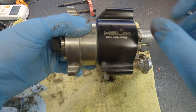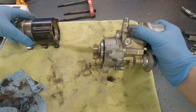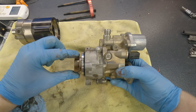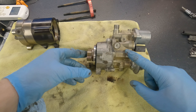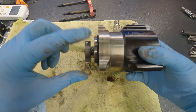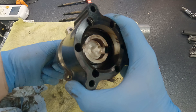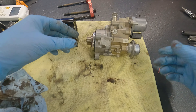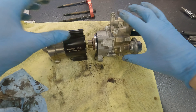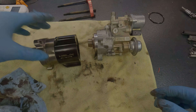Here is the actual Helix Overdrive — part number H3790. Normally your fuel pump sits on the drive chain, and as the chain spins once it pumps a certain amount of PSI into your high pressure fuel system. What this does is: when the chain spins one time, it actually spins the inside three times. That's much better — spin it once and you can see how much faster the inside is spinning. So that will make the pump spin three times faster, providing that much more fuel. There are some tuning changes needed, but they are minimal.